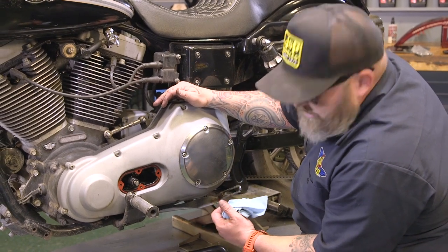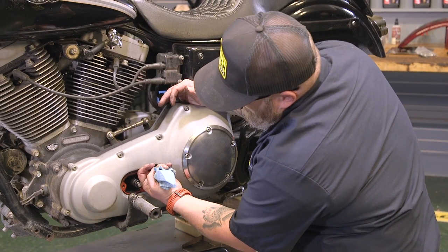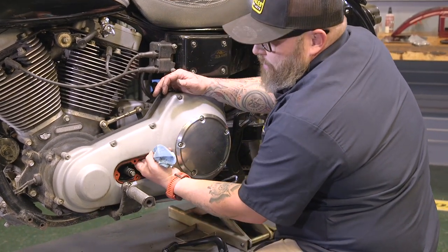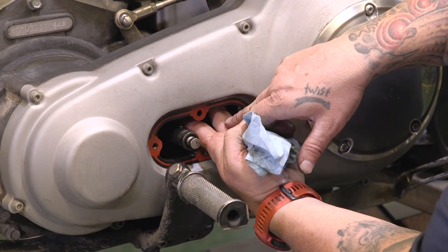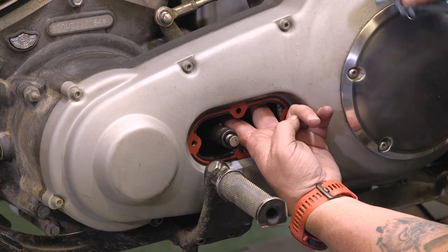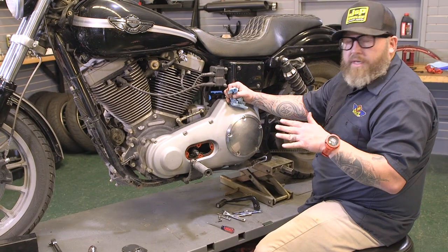You could put some sort of measurement tool up there and try to measure how much the chain is being pushed up, but really you just kind of have to feel it, gauging off the movement. You can almost kind of see my finger here and how much it's moving up — I'm just making contact with the chain and then pushing it up. It's a little more slack than what I want, so I'm going to show you how to make the adjustment.